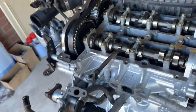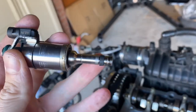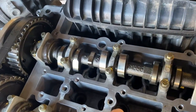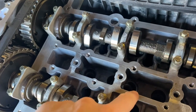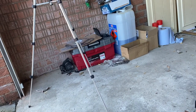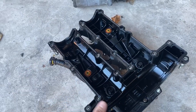I'm getting the rocker cover back off and turning my attention to the injectors. I've got a new seal kit for all three injectors — there's a small seal at the bottom, a plastic clip, and a green seal at the top. I'm replacing all of those. I've also got a brand new set of NGK spark plugs to fit, and the sealant for the rocker cover has also arrived, so I can fit the brand new gasket from the rebuild kit along with the correct sealant for the specified spots on top.